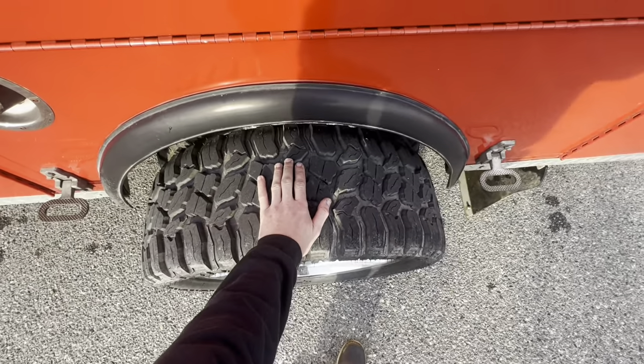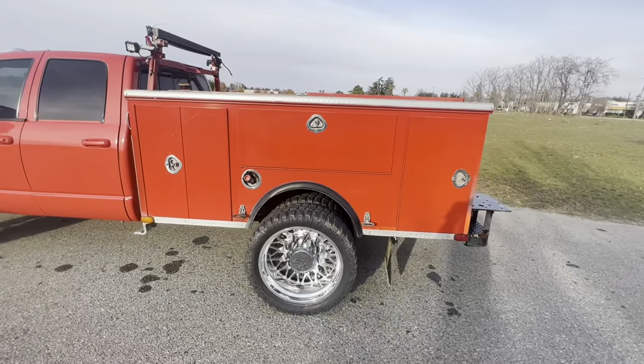I'd say probably a good eight, maybe nine inches. A lot of people had questions about the wheels on this truck. These are custom-cut 24-inch semi wheels. The people that made them are from Riverside, California — big shout out to JK Motorsports. I'll put a link to their website in the description. Great guys to work with, they are so quick and they'll help you with any problems. These are 24-inch blank aluminum wheels — they drill in your exact lug pattern, which on this truck is an eight on six-and-a-half.